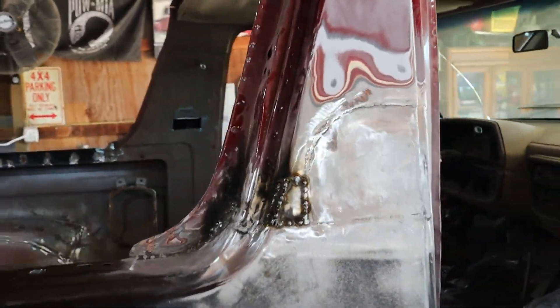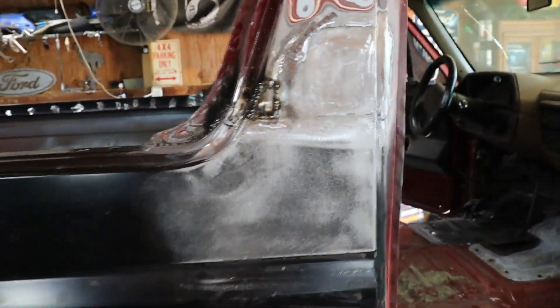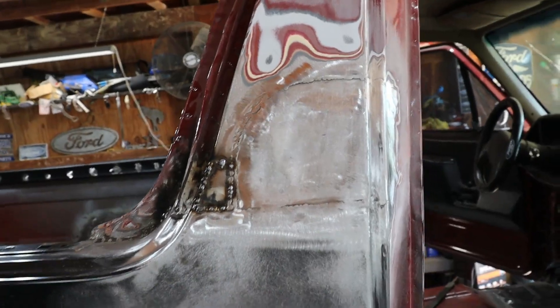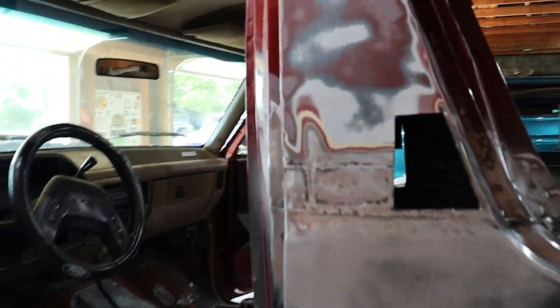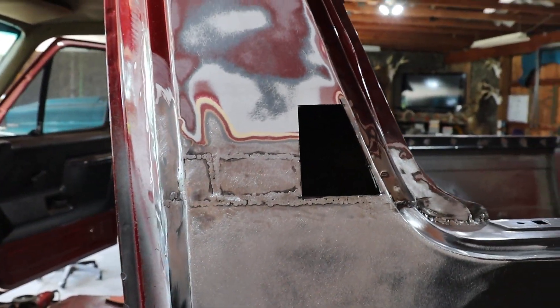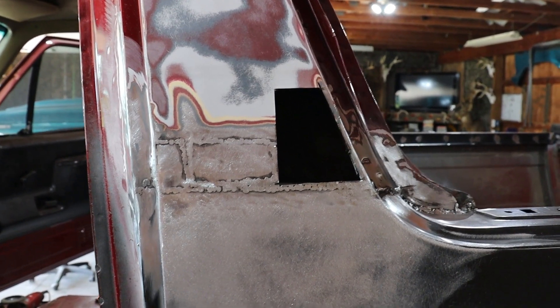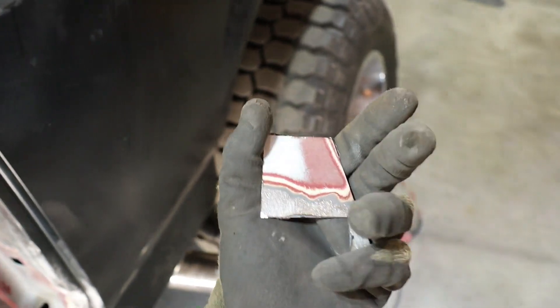Here's a little update on the pillars. While I was sanding everything, getting ready for some Dura Glass filler, I seen a couple pinholes here - poked up the screwdriver - and around here. So I'm in the process of fixing that. Then I walked around this side and hopefully this side is not the same. It was. There's a little hole back here - previous owners cut out to get to the back. There was some previous patchwork that wasn't good. I peeked through that hole and seen that it was all kinds of rusted up behind there. So I figured I'll just cut a big patch out now.